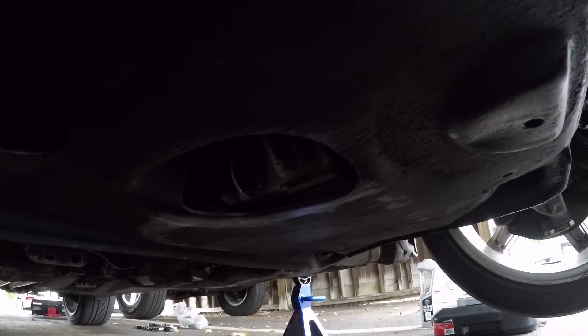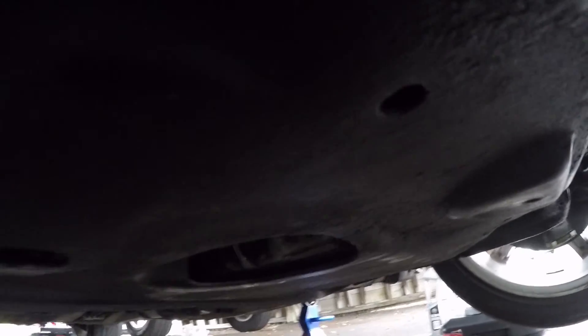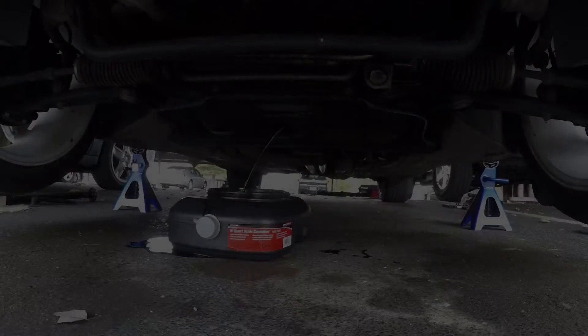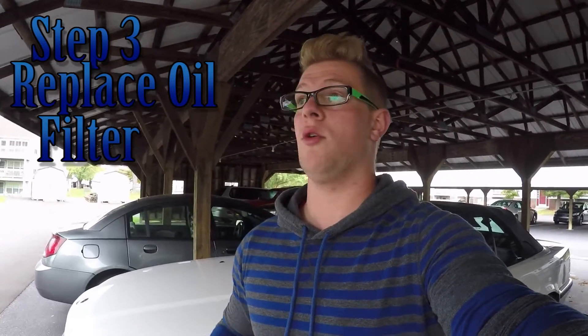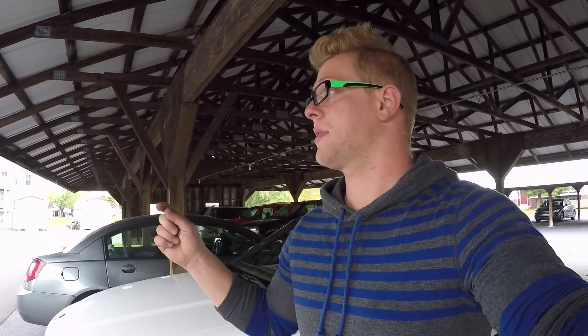You might not have a skid plate under your motor, but all you have to do is find the oil pan and locate the drain plug — it's always going to be on the back side or side of the oil pan. If you can't find it, just Google it. Unplug it, it's going to drain the oil — make sure you catch it in a pan. Now you can see the oil draining into my oil pan. For those without a BMW, your oil filter is most likely underneath or on the side of the motor. Make sure you leave the car on jack stands to access it. Once you pull the oil filter off, make sure the gasket comes off with it. Put a little oil around the rim of the new gasket and tighten the new oil filter hand-tight. Make sure the drain plug is back in, then lower the car off the jack stands.